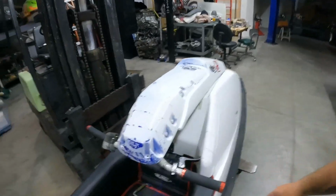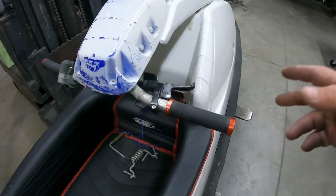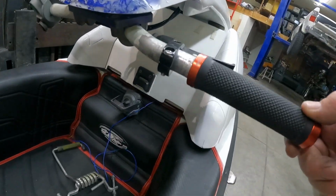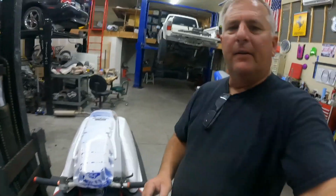Today we're going to look at the Kawasaki 650SX stand-up, the steering. As you know by now, our channel ski, the 650 we built for the channel and we let everybody ride, has quite a few hours on it, and as you can see, the steering is in really rough shape. There's no way to adjust this, there's just plastic bushings inside of there, and then the nut is Loctited on. And there's no adjustment. So I'm going to show you guys the best way to fix this.